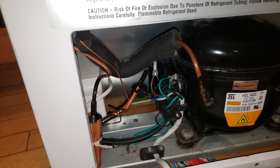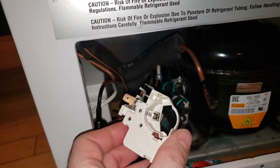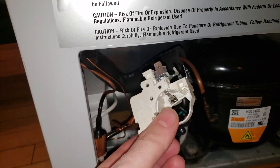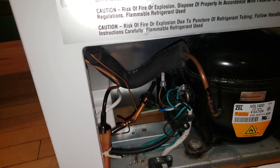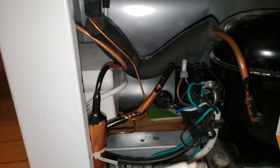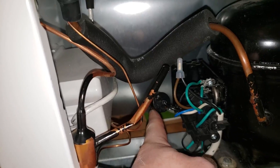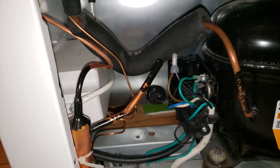With or without the over-fault protector on it, you can get them both separately or together. That's an easy fix - for about five bucks you can basically swap your old one out, put the new one in, and see if it works. In my case, I didn't know if it was going to work because the original piece sells for a lot more money. But through research, people were saying you can use the other ones - you just gotta wire it up appropriately, which I tried to show you how to do on this particular model. So if you have something similar, you can use the cheaper pieces without having to get the super expensive part. Now I have the actual starter relay on there - the small piece - and the overcurrent protection is still right there, which still functions. I pulled it right out of the old unit and it was the exact piece needed.